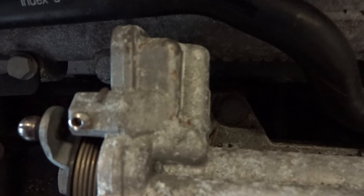Now I'm going to remove this whole thing, which is held on by just three bolts, one there, one there, one there. Then I'm also going to remove this coolant pipe, which is held on by a bolt there, a bolt there, and then it goes into the water pump or thermostat, and that will just come right out.